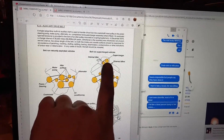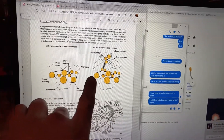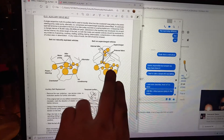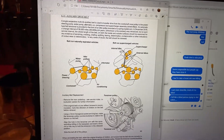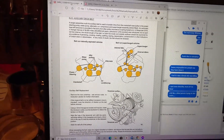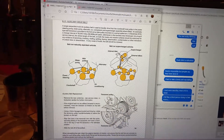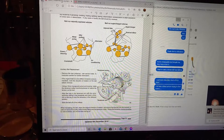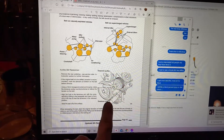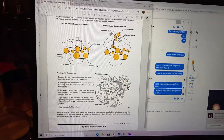Having the extra bit of length coming off the supercharger gave me enough to be able to wrap my pulleys from the bottom, and then I would pull the tensioner and my fiancée would actually put the belt back on the supercharger — and that worked. I was able to manipulate my strength onto that tensioner enough for her to be able to put the wheel on. Good luck though — it is super duper difficult. In this step it says to pull the tensioner arm and put that hex head in there, but that is completely impossible.